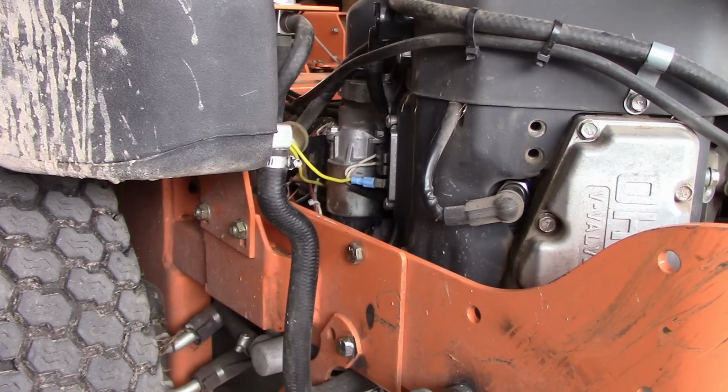And at full throttle 11 point whatever all the way up to 12. So I'm just gonna have to take the other voltage regulator back, and get another one coming. So I know in a few days this battery will be dead because of that low voltage on there.